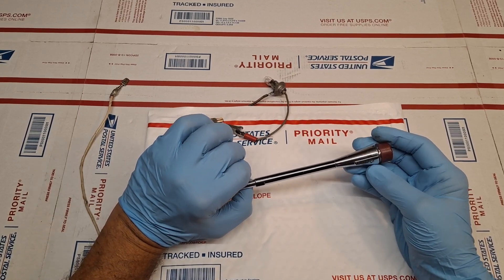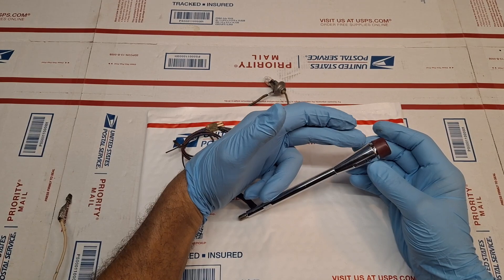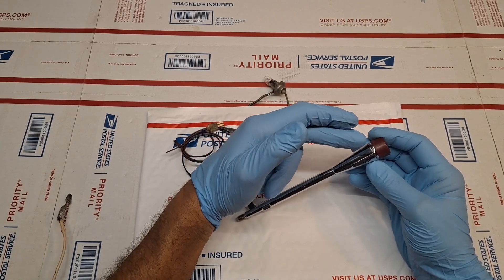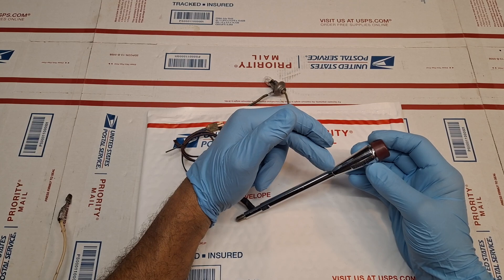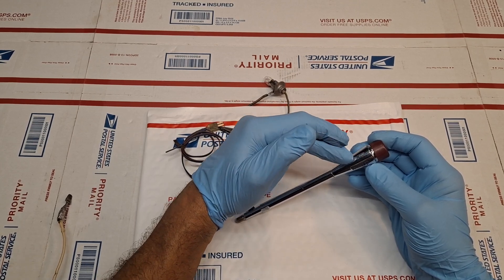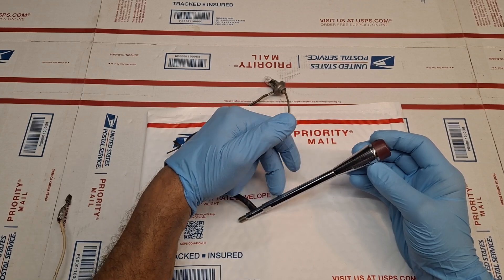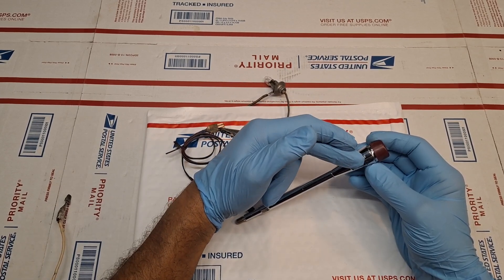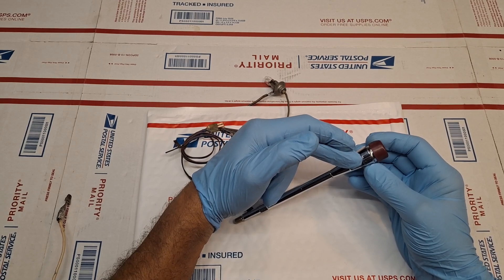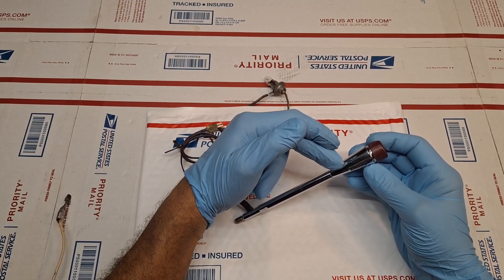This unit was used from 1971 through 1976, but it's specifically 1973 to 1976 that it has bright chrome with the cruise lettering on it. In the preceding years, 1971 to 1973, this was satin chrome as opposed to polished chrome, so in 71 to 73 you'll have a polished chrome stem and the taper will be satin chrome with no cruise insignia embossed on the taper.